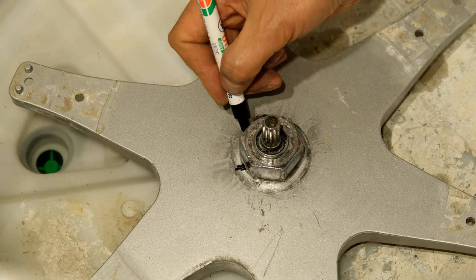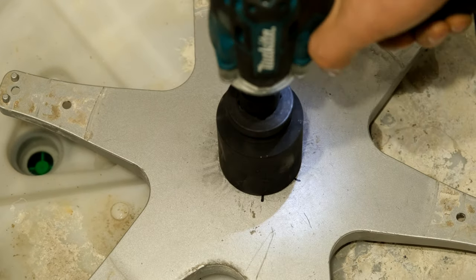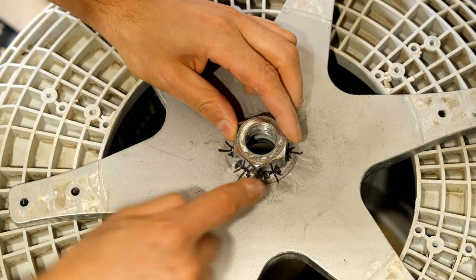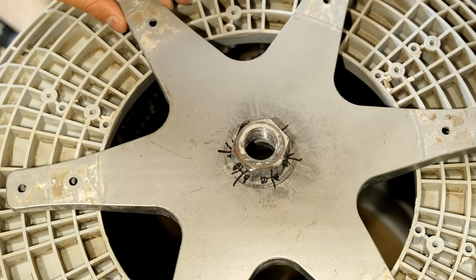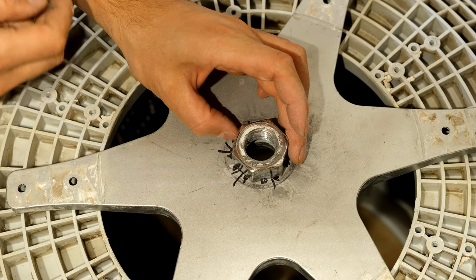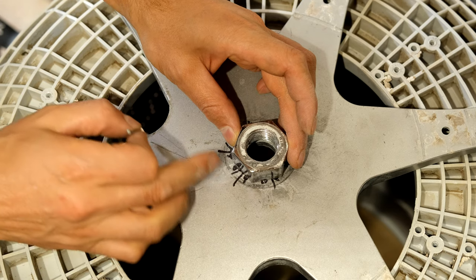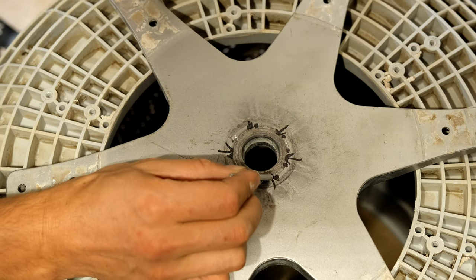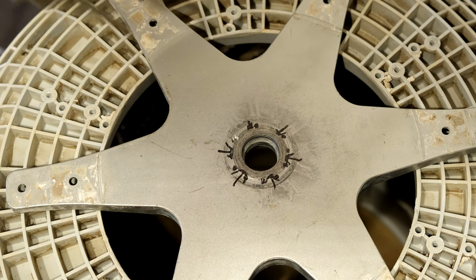That's pretty tight. These are the central points. The nut is here and the arrows show me the middle part. I want to put a rivet here to stop this plate from turning. The nut I'm not worried about turning — it's very tight — and you can also put some Loctite on there to make it even tighter. I want to drill these rivets so the plate cannot move, almost getting stuck on the side of this nut. The closest I can get to the nut is at the head of this arrow, so I'm going to do a first drill here.